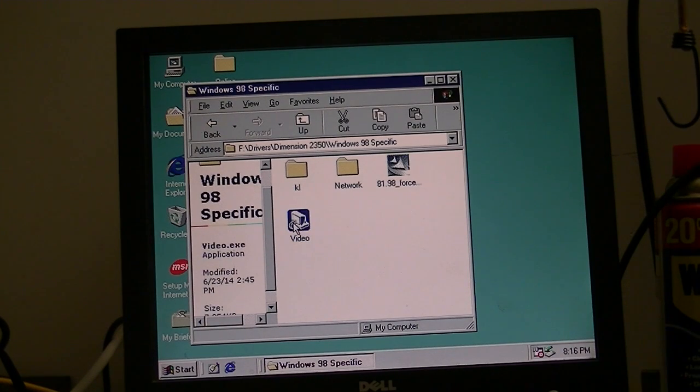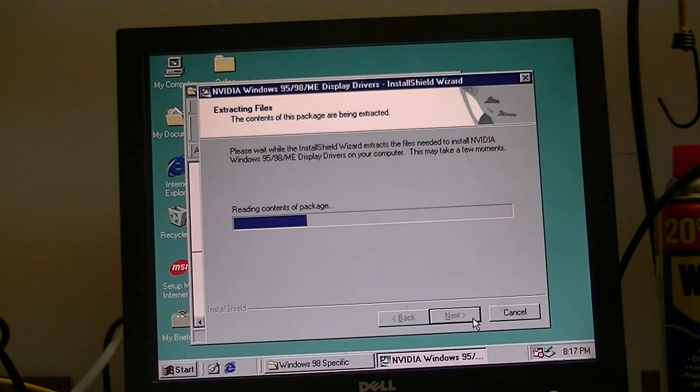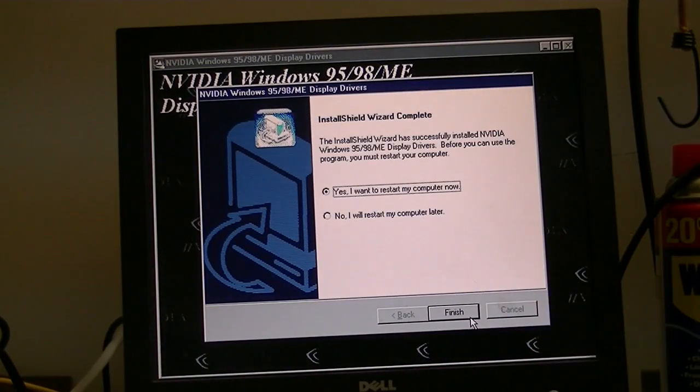Again, this uses the onboard Intel graphics. I forget the exact model number. You will have to search for that because that's not on Dell's website. The one they have on their website works only with Windows XP. But again, I will probably provide in the description a location where you can download this driver. But again, we are not using the onboard video, so we're going to go up here and install the nvidia driver. Okay, we'll just click through all this stuff here, let it do its thing. Again, we'll restart later.